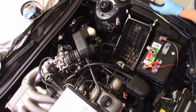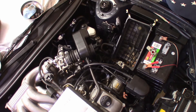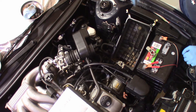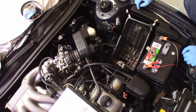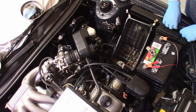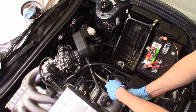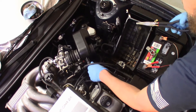This is a good time to replace your air filter if you need to. When you replace your filter, vacuum the inside of the airbox — I've got a bunch of dirt, grass, and leaves in there. Continuing right to left, the next hose is the crank breather hose. Move that clamp off, make sure the seal is broken, and pull it off.